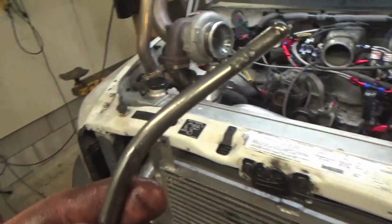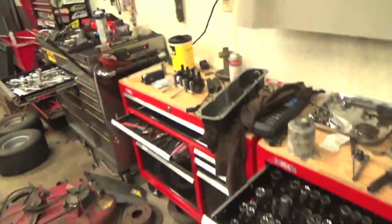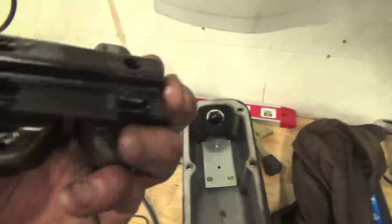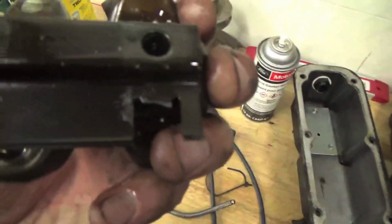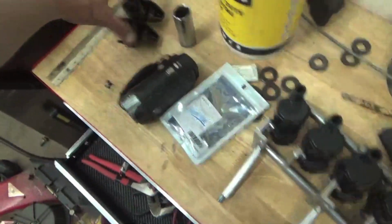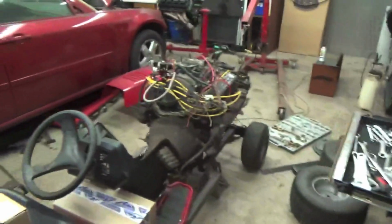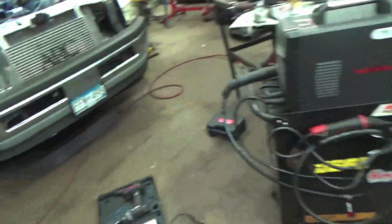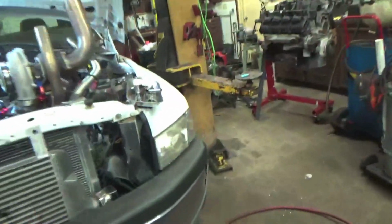It did eat this pretty good though, and also the rocker arm is actually kind of messed up. The guide plate on the bottom of the rocker arm is pretty broken right there. You see nice bend, not nice bend. So good thing Eric's got the parts list, a laundry list of 5.9, 5.2 Magnums. We got 5.9 right there. We also got another 5.9 right there, and a 5.7 Hemi.